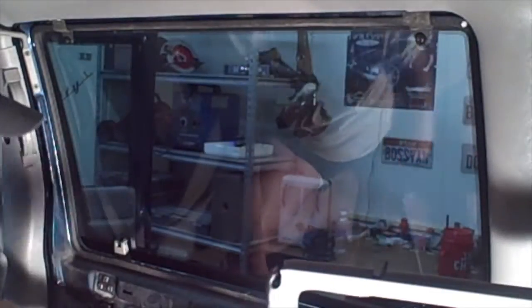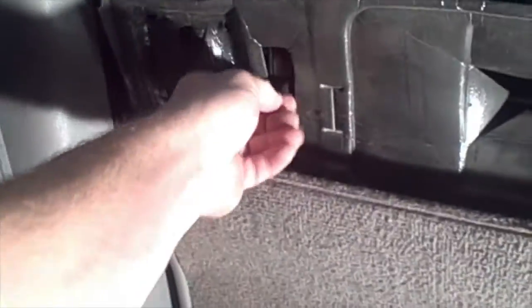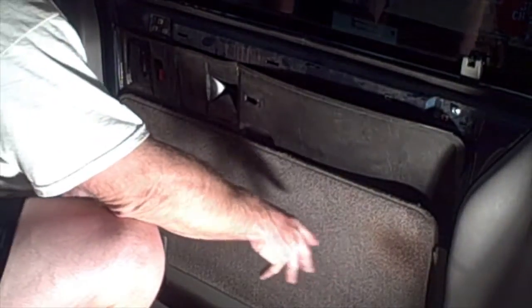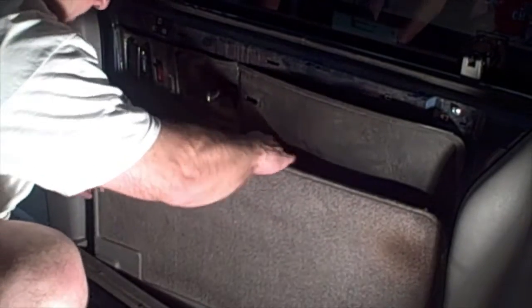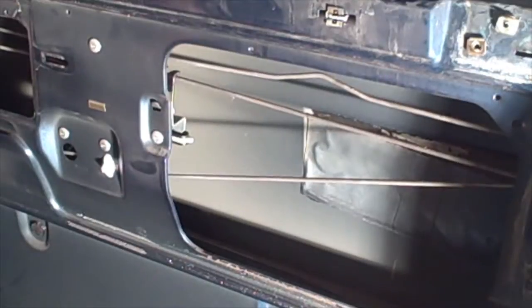Now we can come through and access the door lever and the door actuator, which is right here. You want to open the door just a little bit and make sure you unlock the door. We're going to pop it open just a little bit so we can pull this panel off of the bottom — it should just pop out. This next panel down here has a couple little push pins at the bottom. Just tug on it and they'll pop off. I've had mine off several times; these things wear out quite often on this service van. I'm going to move that out of the way and remove this dust cover.